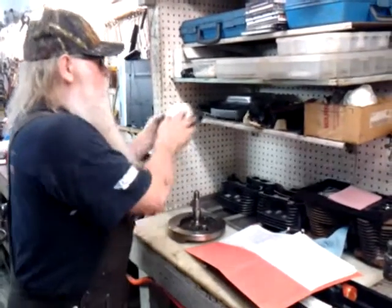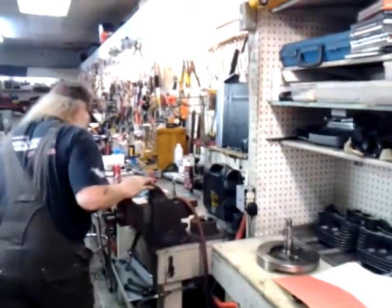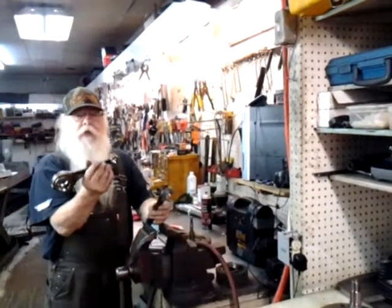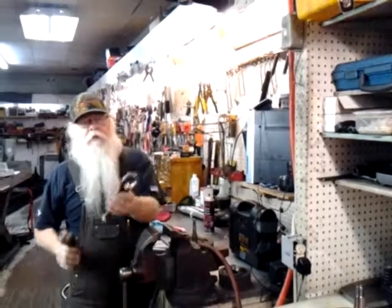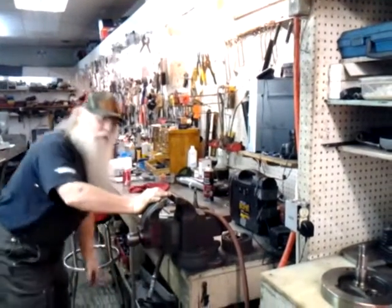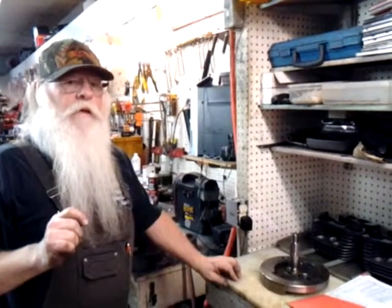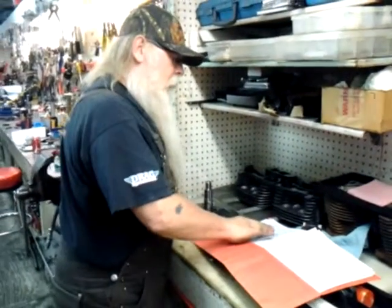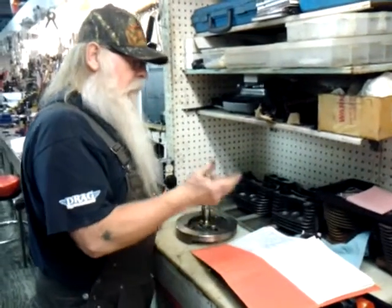I went through and I weighed your rods on each end, finding what the weights are each end of your rod. And I got the pistons — I weighed the pistons, I weighed the wrist pins, the keepers, the rings, everything individually. Then I put them on this paper and down the line you double the numbers and you come up with a formula. So that's called weighing.